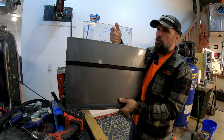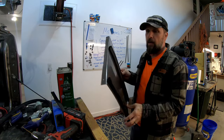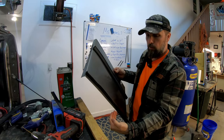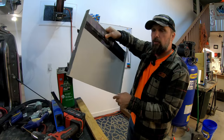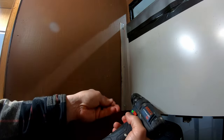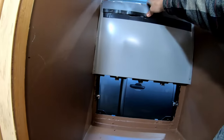This is the redneck air baffle for the back of the fridge that we did our redneck metal brake work on. This side faces out, and this side faces against the coils on the back of the fridge. I affixed it with weather stripping left over from my Humvee project to seal it to the back wall so no air escapes. The flanges are pre-drilled and marked for where we're going to mount it.